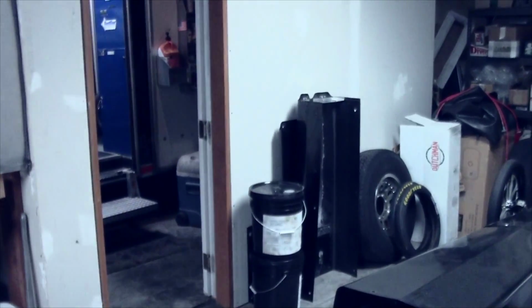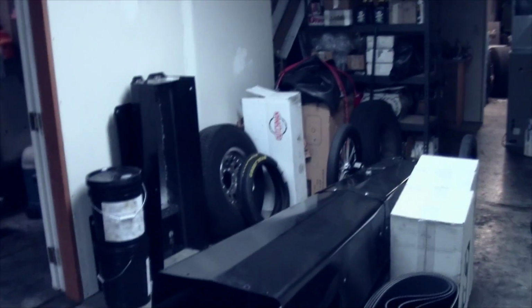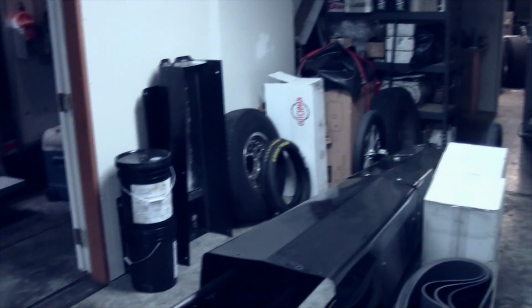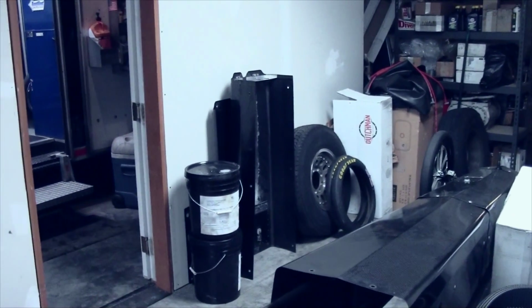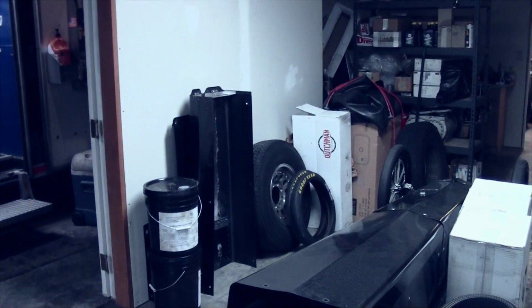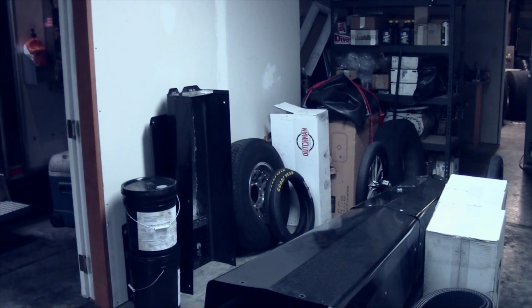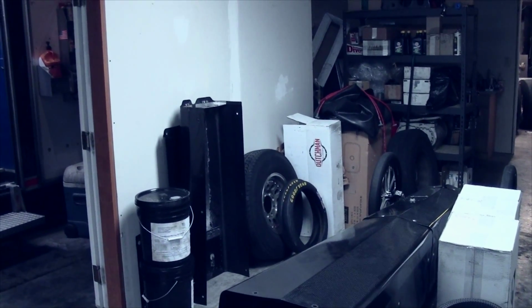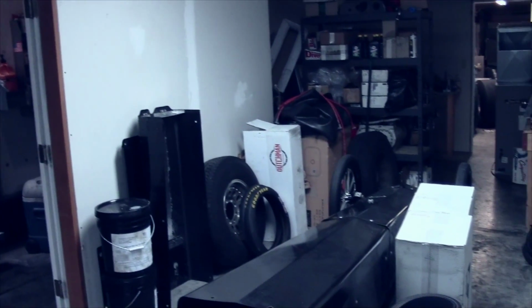I wonder if it's just that newer steel flexes better. They fatigue and they get too flexy, I think. So then the car bows up too much. When it leaves the starting line, if it bows up too easily, it's going to snap the front end up in the air. So if it's stiffer, the weight's out there. It's like trying to pick up a fishing pole with the weight on the end. If you have a real stiff fishing pole, it's harder. But if you have a real flimsy one, you can lift it up that high before the weight even comes off the ground, so you can get a run at it. Yeah.